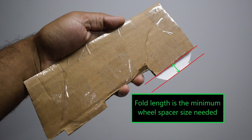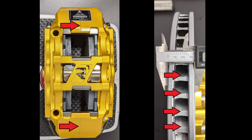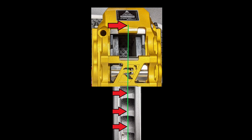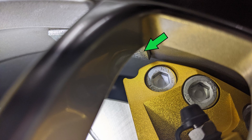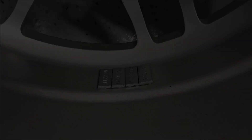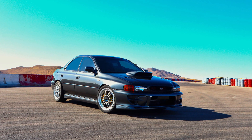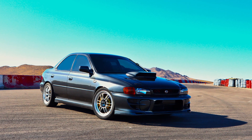The kit comes with shims in case you need to adjust the center of the caliper in relation to the rotor — these fit between the caliper bracket and the knuckle. Make sure calipers are centered with the wheels mounted, and slowly rotate the wheel. I found that placement of my wheel weights would have caused interference with the caliper. The solution was just to place new wheel weights a little further on the outside during rebalancing. So test fit the system and pay attention.